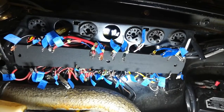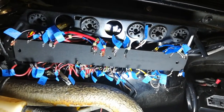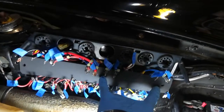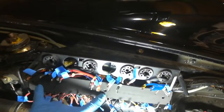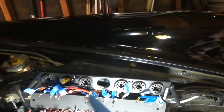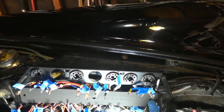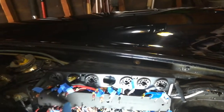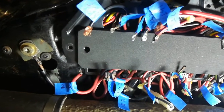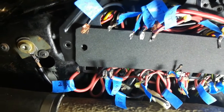After you've wiped down the mounting surface for this gasket, keep in mind that at least on the ADAPT Motorsports panel, these three bolting locations are not symmetric. Make sure you have the gasket in the correct orientation before you stick it down. You're supposed to end up with these three existing holes on the metal panel beneath it exposed so that you can mount the standoffs and the screws in there after you put the panel in place.